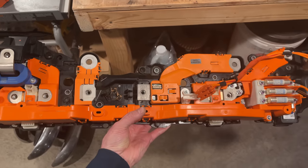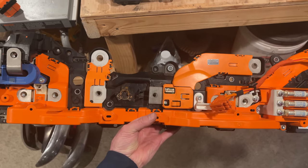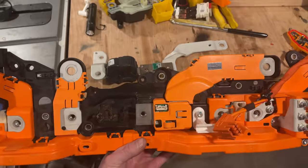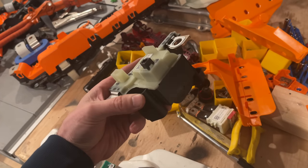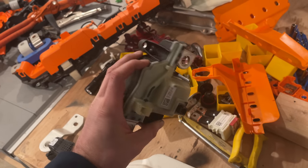This part I bought to replace my broken connector also has the mounts for that assembly, so I can cut that part out and mount it directly to the battery if it's feasible. I might also try to move the contactors inside the battery case. This would be a safer design — if I have exposed high voltage cables that are always high voltage, that could be dangerous.